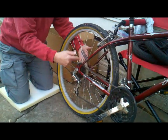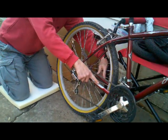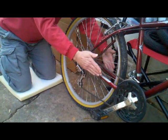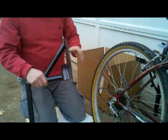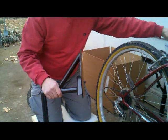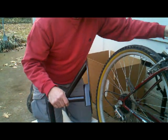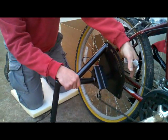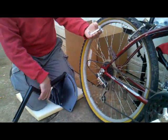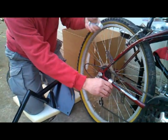On this style of bike with a derailleur, the angle of the chain stays is 9 degrees on each side, so 18 degrees total, and that's what we have these plates welded on at that angle. On a single speed bike, the angle is different, and you'll need to use spacers to account for that, which I can explain later. But for this kind of bike, in order to help clear the chain in the higher gears, you can use 3 of the 4 included spacers on the right side where the derailleur is, and none on the left side.